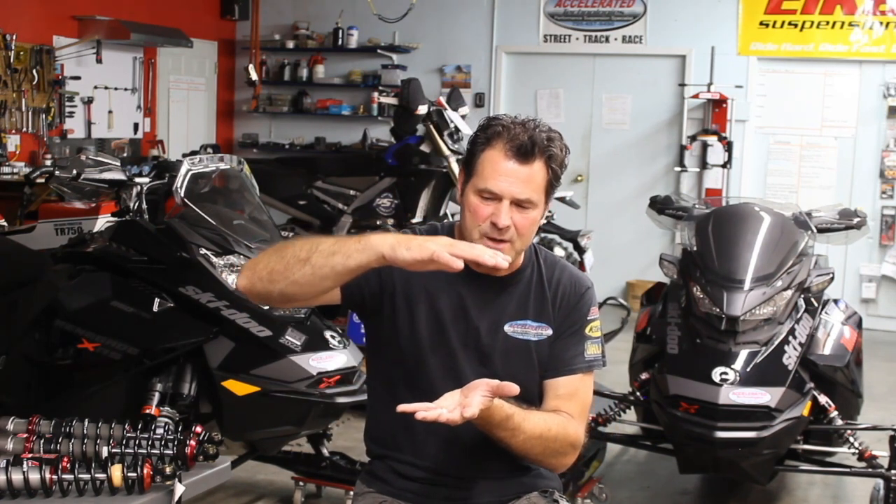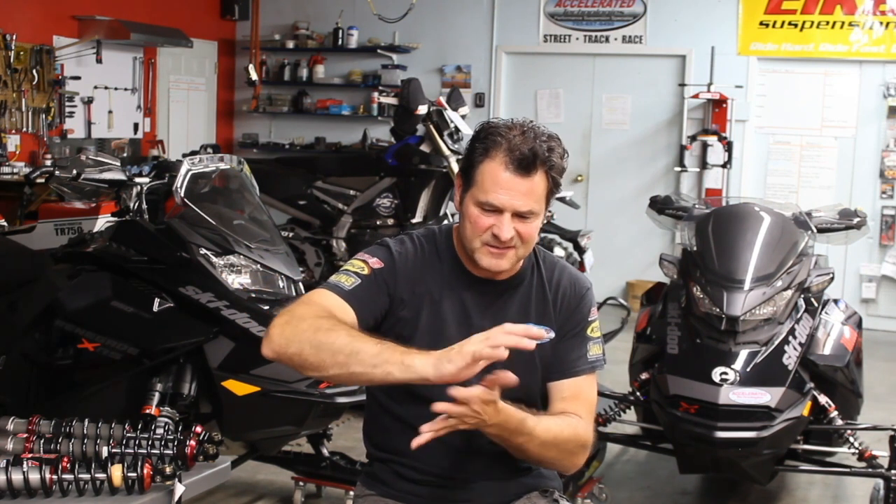We're there with you after the purchase to answer questions and work with you to keep the vehicle at ride height. If the rebound is too slow, it packs down, the skid couples, and it bottoms — it's uncomfortable, you feel it in your back, legs, and arms. Getting a good shock package in a machine is really instrumental. We work here with Elka Suspension — they make an amazing product with incredible adjustment — and we'll work with your budget to recommend something that will blow you away with an unforeseen level of enjoyment from your snowmobile.